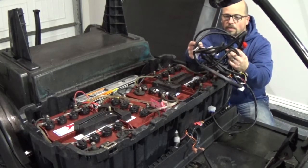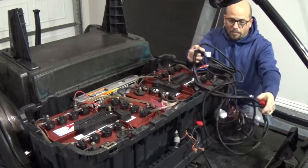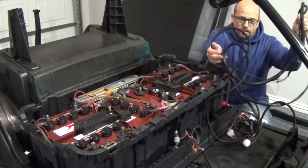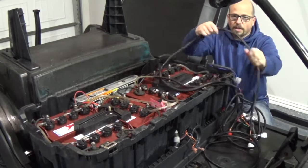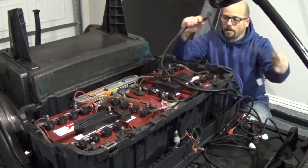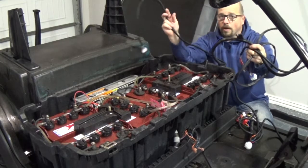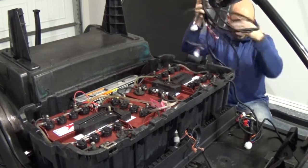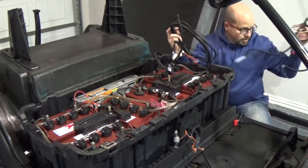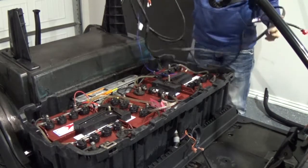I've got this big mess of wiring harness that might be a little intimidating at first, but it's pretty self-explanatory. We're going to pull this harness apart — this front section runs through where we pull the floor mat up for the front headlights. That goes back and branches off one harness on each side for the tail lights, and there are a few other harnesses that plug in up front under the dash. Right now I'm going to run the harness through to the tail lights.